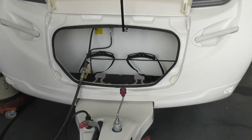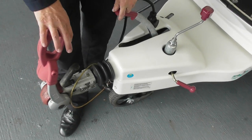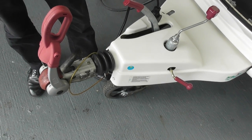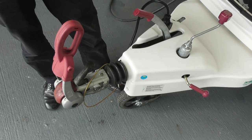Okay, right, front end. So this is obviously your towing end stabiliser. I don't know if you had that on your previous one. Yeah, you had one of them, so you're happy how that operates? That was just the pads, isn't it? Yeah, that's it. Usually friction on the tow ball. The tow ball needs to be clean, grease-free and paint-free. Yeah.